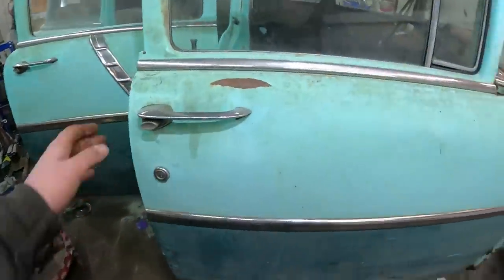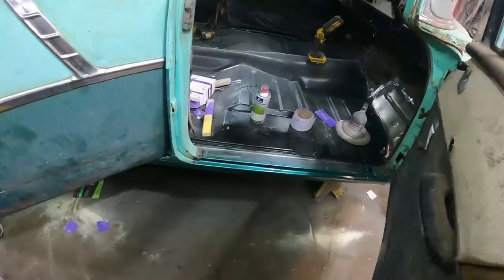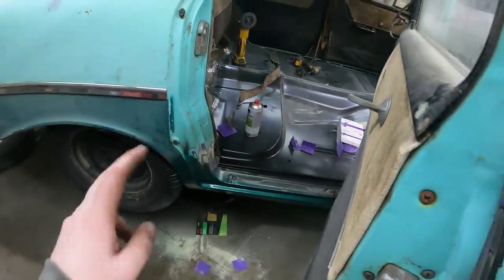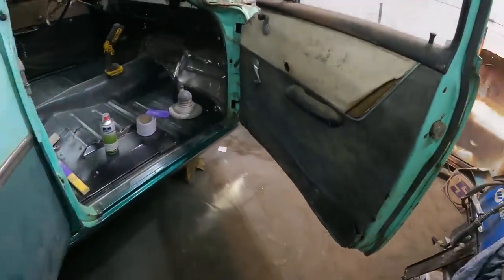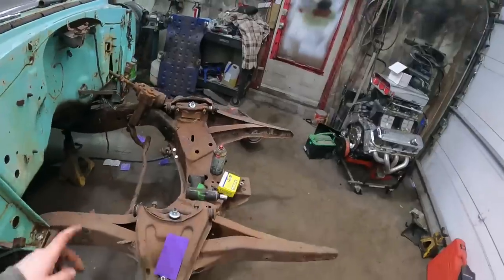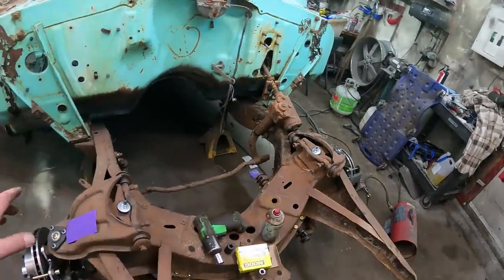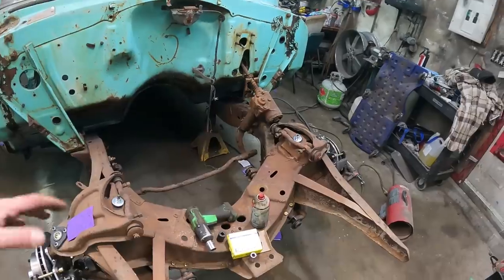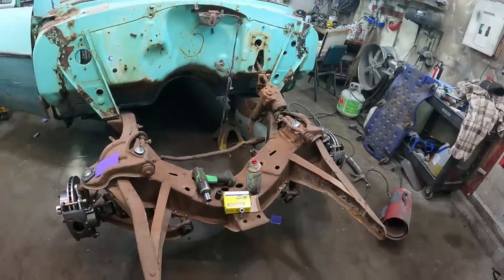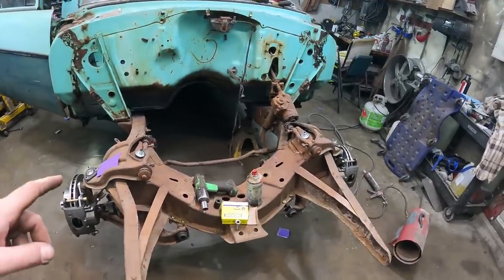As promised, I got the dark green on the bottom. We gave it two coats. So I sanded it, gave it one coat, and while the first coat was drying, I pressed the last bushing in the steering box and put the box back in, and all that. Now there's no tie rods on it because I'm missing an adjuster, like I said, but we can slam the motor in and get prepared for that, which is nice. And if it has to come apart, it's all easy and nothing's cut or pinned or anything like that. So we got that dialed.